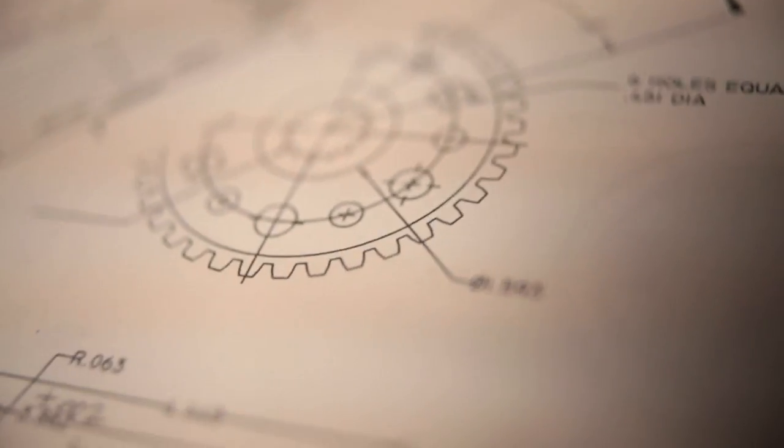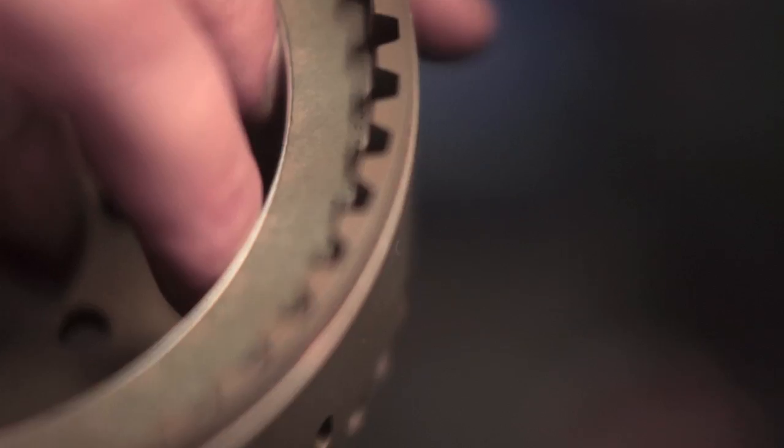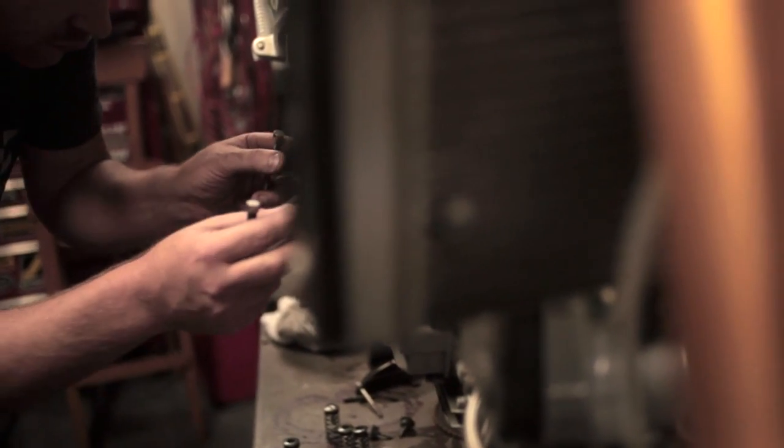Basically, the concept is that one plate is like the leader plate, and the rest of them follow the leader. And this one plate that's at the top is precisely made to exactly match the basket that I call the stabilizer plate. And the second was to create a clutch that would be slippable and that wouldn't give clutch judder. That was a special spring plate that allows those shock loads to be absorbed but without affecting the feel of the lever.